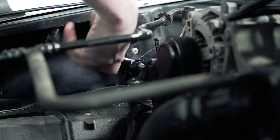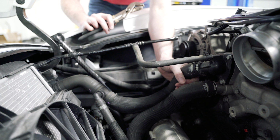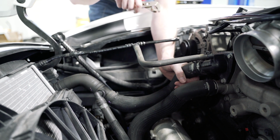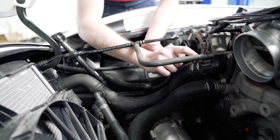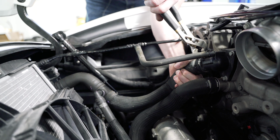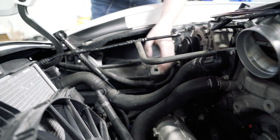We're gonna start here by taking this stud out of here. This will not be reinstalled. Next, by rotating the radiator hose where it connects here to this water outlet, we need to rotate it counterclockwise. And we're gonna take this little line and move it till it lines up with, there's a bump on the top here. Just squeeze the clamp and rotate it. And then reset the clamp.